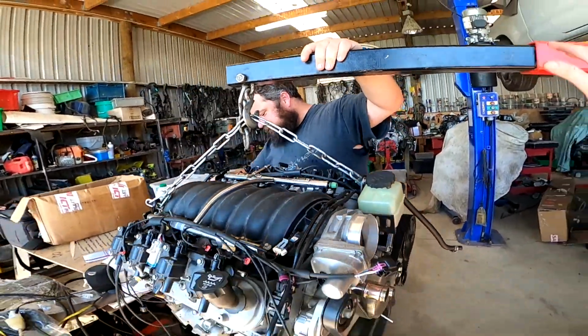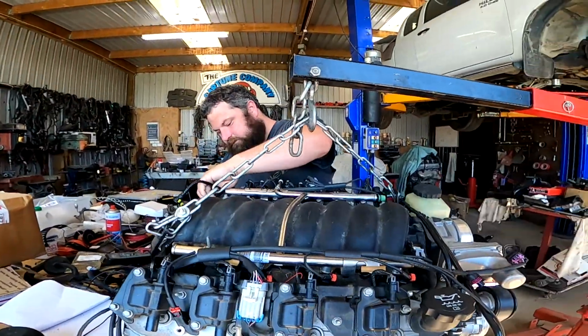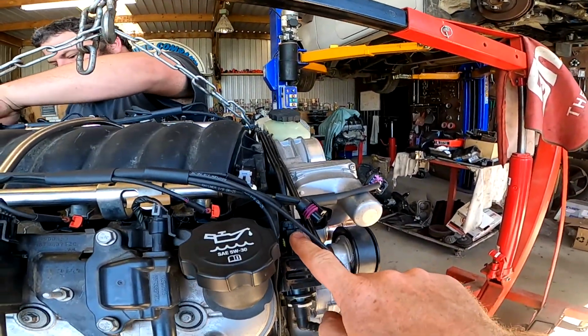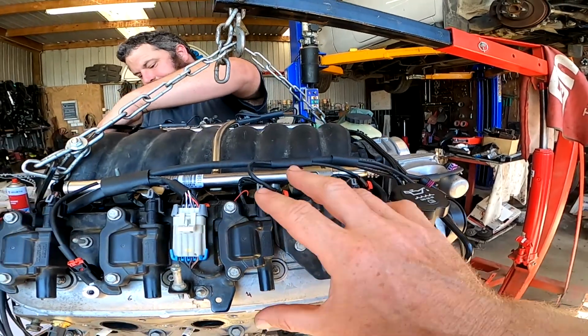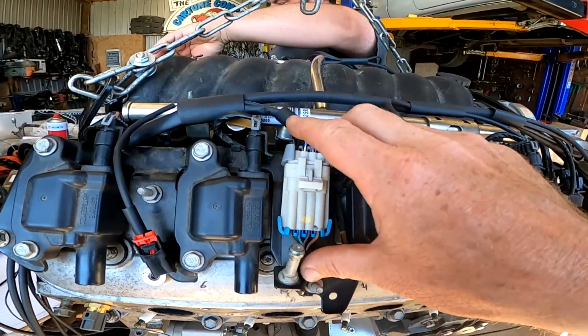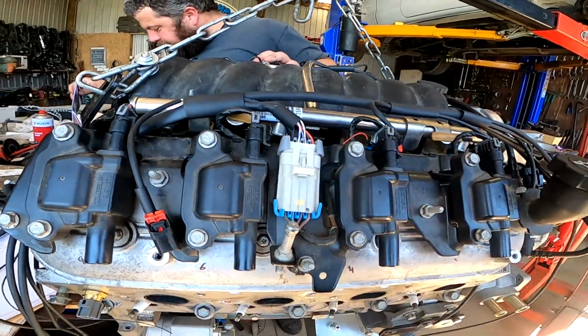And we've used the Link software for things like the drive-by-wire. All the plugs are new except the purge. They didn't have a purge. We haven't remade the coil looms. They're factory. We've just plugged into the big coil plug there.